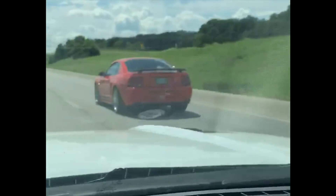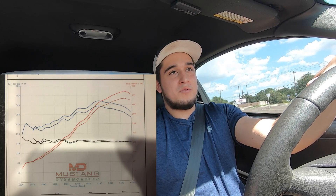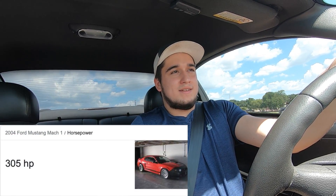This car rips now, and I thought it ripped before, but this is just a completely different animal now. The first time I put E85 in my '14 GT, it was way different. You're going to sacrifice some miles to the gallon, but in the long run, to gain 20 to 25 extra horsepower from just fuel alone — I'd say it's worth it. Crank horsepower is looking about 461, so 461 horsepower to the crank, 401 to the wheels. So from 310 to 461 — that's about 150 horsepower added.